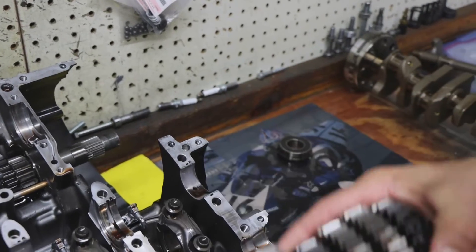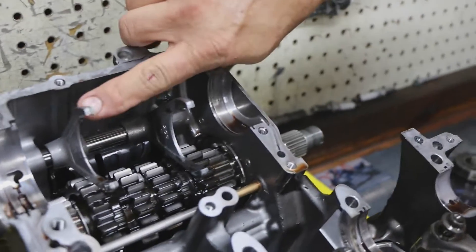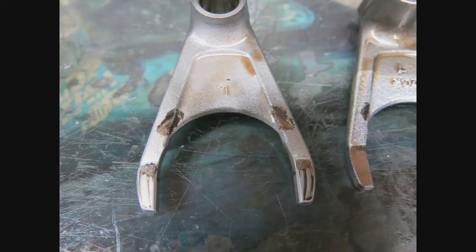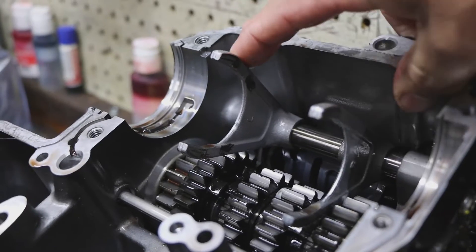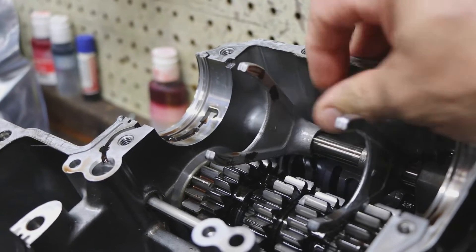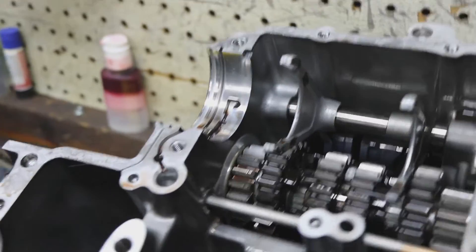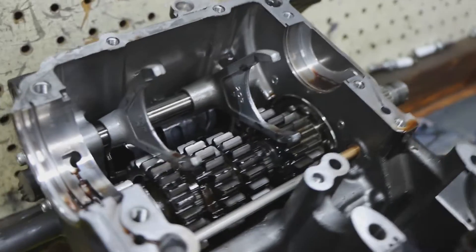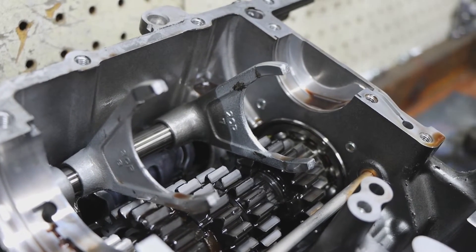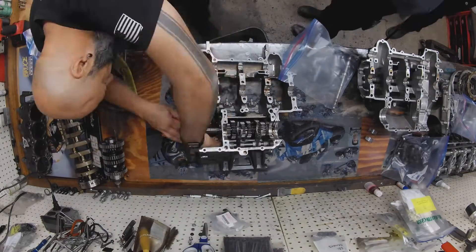When you have a transmission like this, the next thing we do is look at the transmission shift forks. You can see these dark marks — those aren't supposed to be there. That is happening because the bike is in gear and these are where they're supposed to be, but every time that gear jumps out, it's pushing on the shift fork, which is creating all these burn marks and will eventually wear it down. So as the gear wears and the shift fork wears, you get more and more play, which is why the problem gets worse. More shifts jumping out causes more damage, causes more play, causes more severe shifts jumping out.